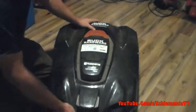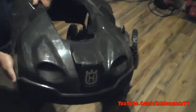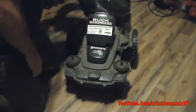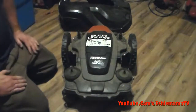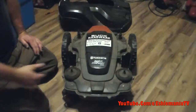After you disconnect the wire, just grab the body and give it a good tug in the front and the body is free — this is the top part here. This area has your charging plates and there's a little magnet in there that works with your collision sensors. If that little magnet falls out it will create all kinds of havoc. The next step is to go around and take all these little screws out — they use a Torx head screw — then flip the top of the body off.